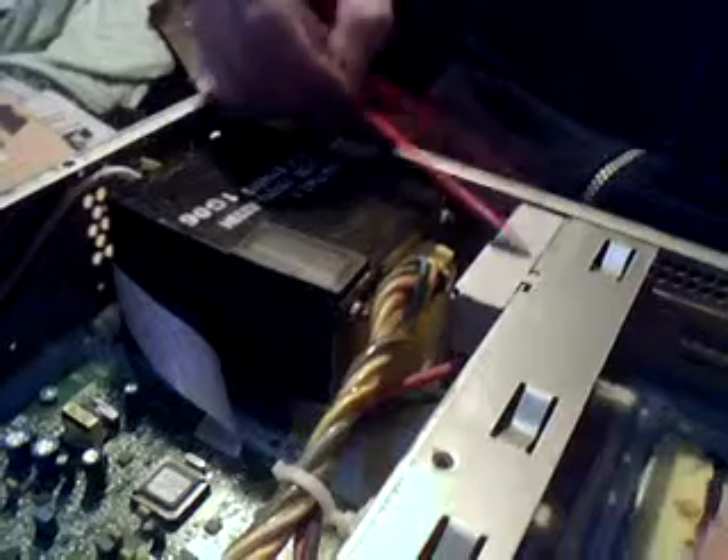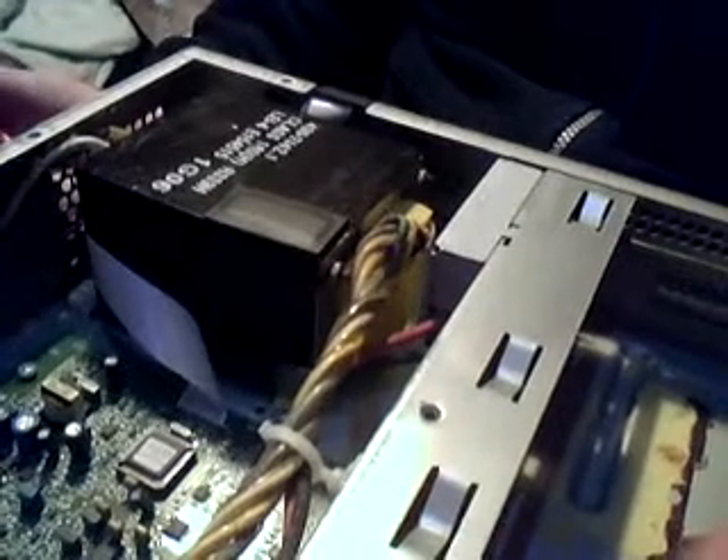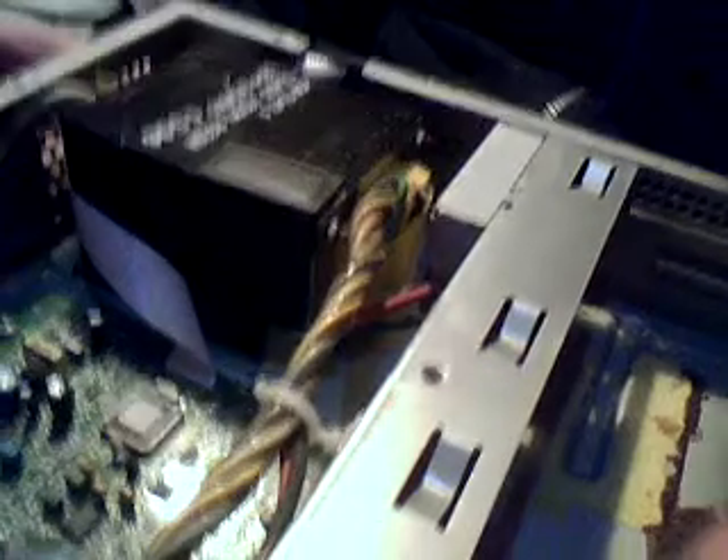The batteries I've stuck on it — I think it's about 50% more capacity than what were originally there. That's the original battery tray; the black residue was from the previous owner who had an acid leak. When I looked at the pricing to replace 4 batteries, it was actually cheaper to buy 2 bigger batteries and simply wire them up. There's a high-amperage connector at the front for the batteries, connected by a 60-amp fuse.